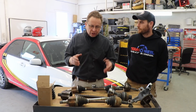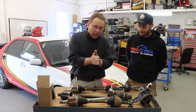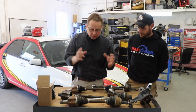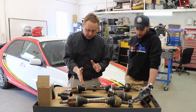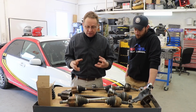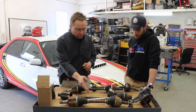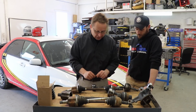The racing clutch can have a big impact, it's like it's just off or on, and I've seen cases where you put a stock clutch in and it absorbs that energy. Stock engine mounts can absorb some more energy than making things solid. So that's another problem: is it breaking because of too much power? Is the axle breaking, or is the CV joint breaking?